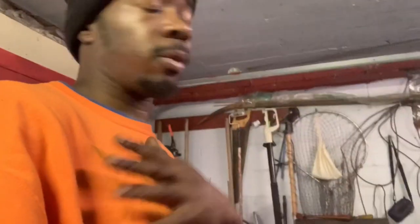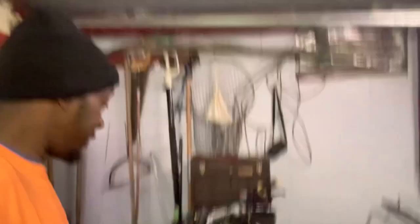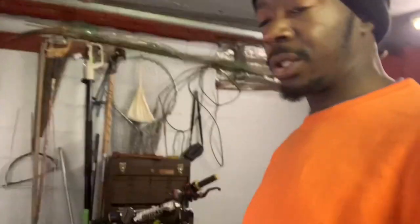I appreciate y'all for watching. If you have a Grom clone, this is a mod you need to do — change the fork oil. I waited a thousand miles before I did mine. Don't be like me. Do it as soon as you get the bike, fresh out the box — it's a better feel. Changing the fork oil will help tighten up that front end bounciness. After I sat on it, it already shrunk about 2 inches and I'd hit the brake and feel the whole bike bottom out — now it doesn't bottom out at all. Hopefully this will feel better in the stunt lot. Stunt lots coming soon — this bike is going to be in the lots a lot more often.